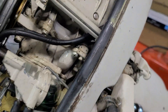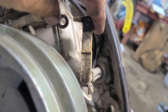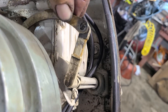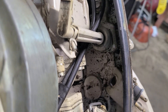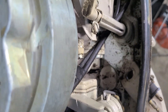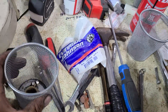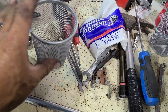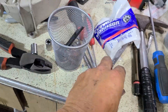In order to take the power head off, you've got to disconnect the spark advance and throttle linkage right here. Just pop the stainless clip off of it, just like this. Put your parts in whatever kind of organizer you like — I get these at Family Dollar, they're a buck and a quarter. You can see through them pretty good. As I'm doing each motor, I put all the parts in its own separate little wire basket.